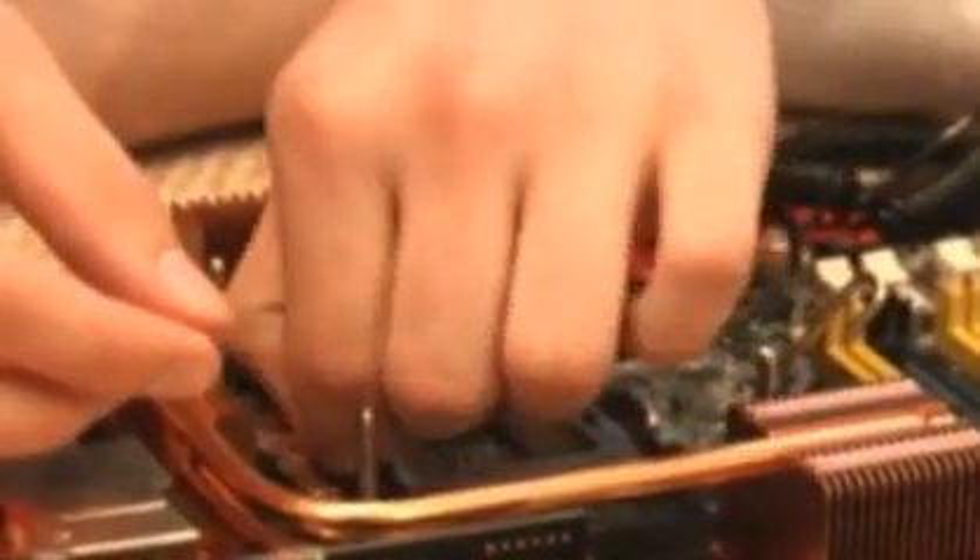That passes through nicely and I'm going to flip it over. You can see it's poking through and now we'll install the top portion. Next we're actually going to install the cooler for the CPU. In this particular configuration, you put the CPU in the socket first, then you put the CPU cooler on top of that, and then you button it down using screws and springs which screw into the rods we passed through before. We're going to remove this cover which comes on top of the CPU. We're going to open up the CPU bracket — that's just a rod that lifts up — and this lifts up like that.